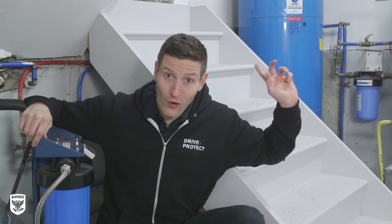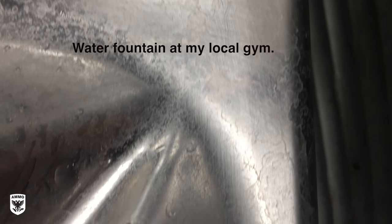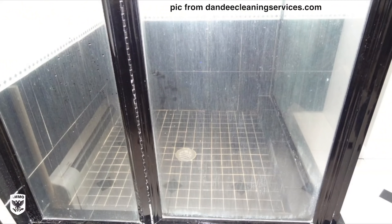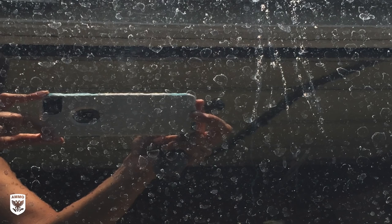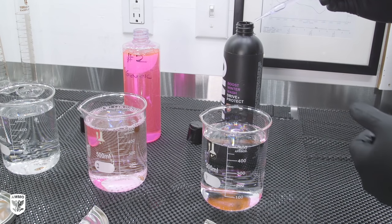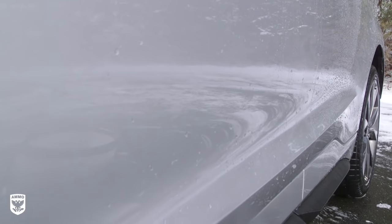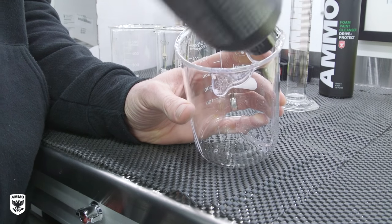Benefit 3 is near and dear to my heart. When we moved to the new house, we got well water, and despite all the filters we still have hard water. I needed to create a formula that rendered the hard water inert. Hard water is basically water with too much mineral content — usually calcium and magnesium carbonate — much the same as typical shower scum. In the car washing world, this causes the soap to have minimal suds and can leave behind white circles known as hard water spots on paint and even glass, which are super annoying to remove. Winter Wash uses a process called chelation, a type of bonding of ions that essentially grabs the hard water metal ions present in the water and renders them inert, thus avoiding water spots altogether.